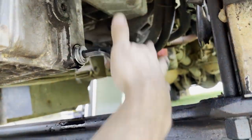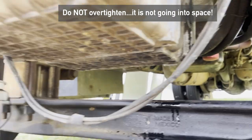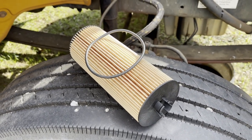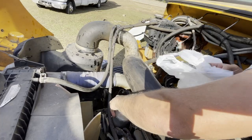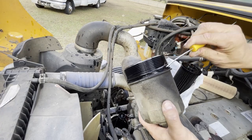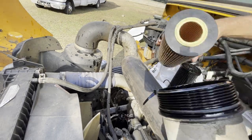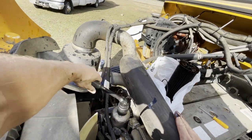If your drain pan was large enough, you could let it drain while removing the old oil filter and installing a new one. This engine, and most Mercedes engines, have cartridge filters which can be accessed from the top. I'm a big fan of this style filter. Use a 36mm socket to remove the filter housing, pull the old filter out and drop it into a bag. Also get the old O-ring out of there. Install the new O-ring — which is easier with two hands — install the new filter into the housing, then screw it back into the engine by hand and then with a socket. Make sure you don't over-tighten this.